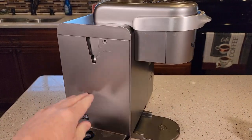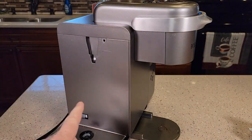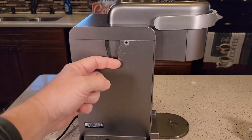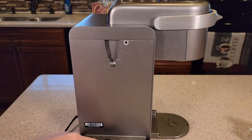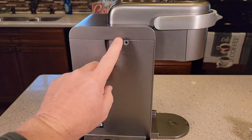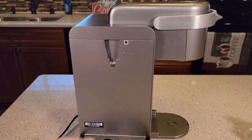If you're tuning into this video because your add water light doesn't work — up here it's got this add water light. If that light's not coming on, there's the vent for it. Inside here, when we take this apart, you'll see there's an add water light box that's got two wires going to it. As the water reservoir has water in it, so does that box. That's the vent for it, so if that vent gets clogged, your add water light won't work properly.